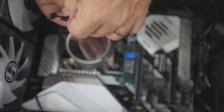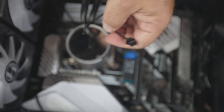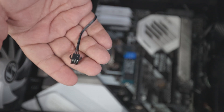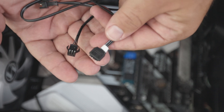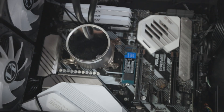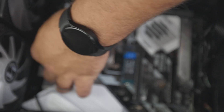The RGB is going to go through to the backside of the case to the RGB controller. Luckily with my motherboard — this is the connector for the RGB that came on this AIO cooler — my motherboard uses these kind of connectors for RGB. Luckily my motherboard came with an adapter, and yours should too. You should have a couple extra wires that came with your stuff.